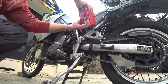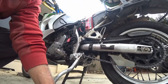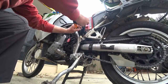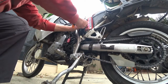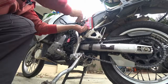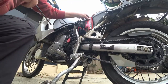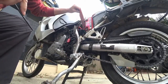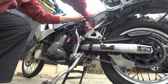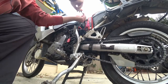Okay, let's put the battery back in. Odyssey fits nicely on its side. If you use positive to the bottom, you don't need to bring in any new wiring. It's just a little bit of rerouting and it will fit. I do normally have some spacers in there, some sheets of vinyl, and I'll leave those out just while we test. And of course, the joys of working outside means it wants to try and rain right now.